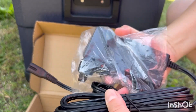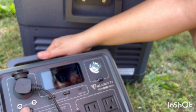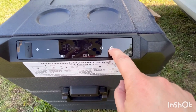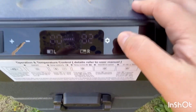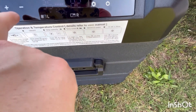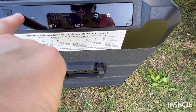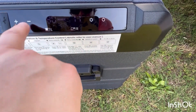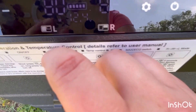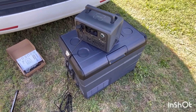Here's your DC cord — really long and convenient — and there is your AC cord. Now let's plug it in and turn it on to see how much power it actually draws. I've turned on my DC; let's turn on the cooler and set it. I like to set my fridge to 35°F and my freezer to 10°F. I've set it on eco mode, and it's currently pulling about 51 watts.